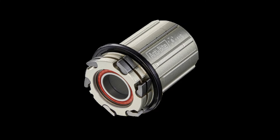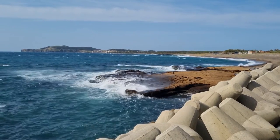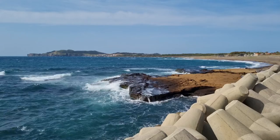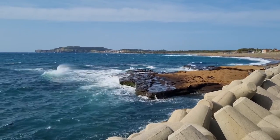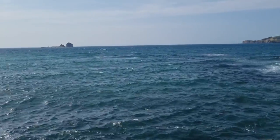One characteristic I'm very familiar with is the creaking that happens after about 1,500 kilometers. This has happened on almost every wheelset I've ever owned and comes from lubrication in the freehub getting cleaned out, drying up, or getting dirty. The last note about ride quality is wind stability. Overall, stability is acceptable but not perfect — the wheels are not much affected by strong constant crosswinds or even sudden gusts, but there are some brief wobbles that seem to come more from a stalling effect rather than crosswinds themselves.